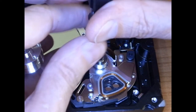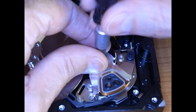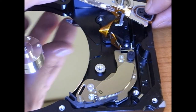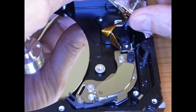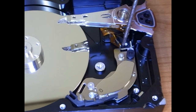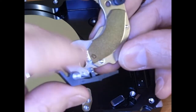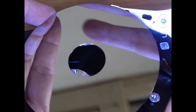The swing arm is held down by a flat head type screw, so I can remove that. Get that out of there. It's not hung up on the disc — there's the arm and the screw, and it's held down by a cable. So here's that other magnet we were talking about right there, another good target to remove. The disc will come out of here now. Lifting that magnet out of there — there's another one of the goodies. Let's see if I can take the disc out. There we go, there's the disc. That's another interesting thing.